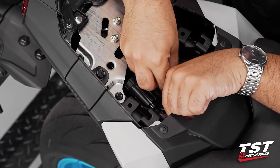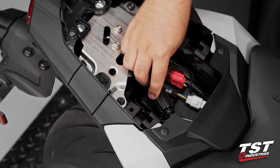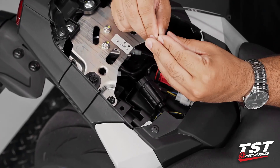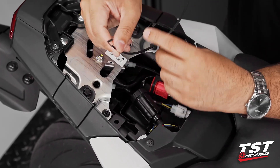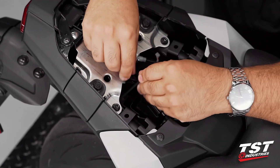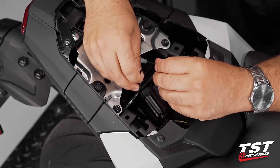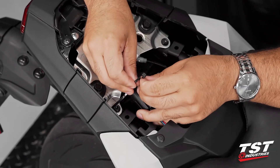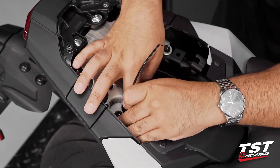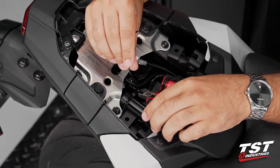This trunk space doesn't have a ton of room — there is limited real estate for placement. What I've found works is grabbing one of the included zip ties, bending about an eighth of an inch at the very tip to create a hook-like feature. Next, route it underneath the rearmost portion of the frame and gently push upward, allowing it to curl back towards you. At that point, route the wire around the channel on the brake light modulator housing.